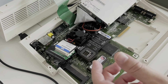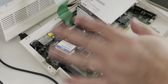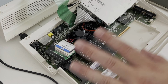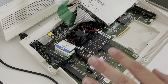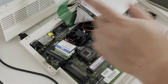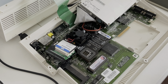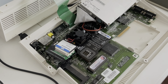Capacitors prevent spikes and under-voltages. Technically, under ideal voltage situations where everyone's playing nice, you can run a computer without capacitors. Even though these have leaked and drained and done gross things, the computer still works — but they do need to be redone. You obviously do not want to continue using a computer with bad capacitors. So the RF modulator needs to come out to make room for the HDMI output. I can try snaking it out the trap door or the side, just leaving the lid off. But first I need to clear my A630 accelerator and compact flash hard drive.